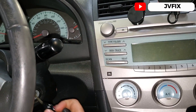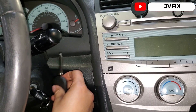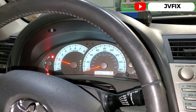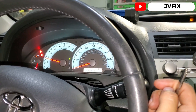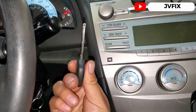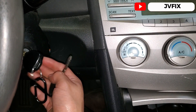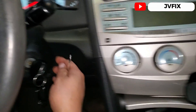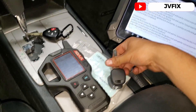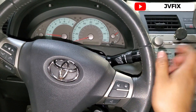We already programmed this key successfully. I had to do the procedure quickly — opening the switch five times — and now the light is out and the car starts. On this Camry you don't actually have to remove the whole immobilizer box to program keys. Since the customer wants to use this key, I'm going to clone it and make a copy so they have a spare in case they lose it, because the process isn't simple. That's how you do an all-keys-lost programming for a 2007 Toyota Camry. Please subscribe, comment, and turn on notifications — see you in the next video!